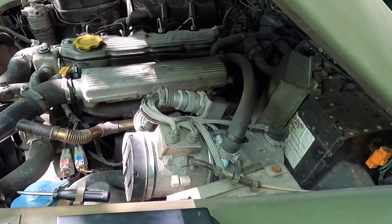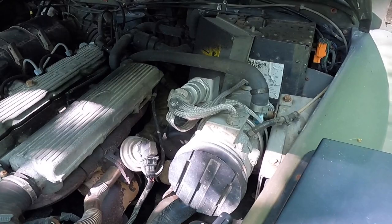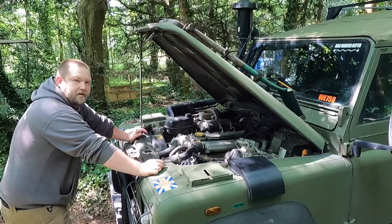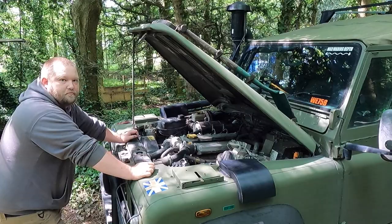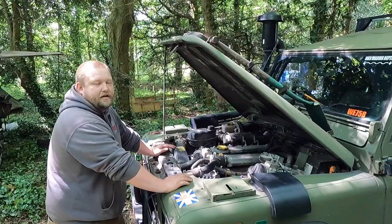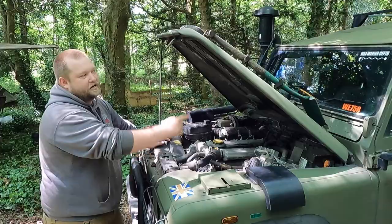The final thing is part of the winterization kit — a Webasto diesel heater. It sounds like a massive jet engine compared to normal Chinese diesel heaters. This is a 12-kilowatt diesel heater, not a typical two or five kilowatt. The exhaust vents straight down, it's piped into the engine coolant as a preheater, and the coolant also feeds a six-inch radiator under the battery compartment to warm the batteries. A second pipe feeds two three-foot-long radiators under the passenger seats in the back, keeping the cab warm. They're rated to minus 40 degrees Celsius.